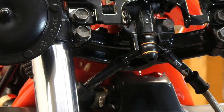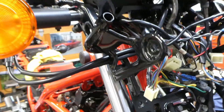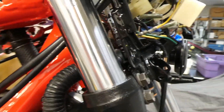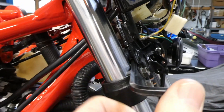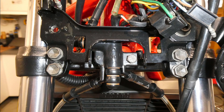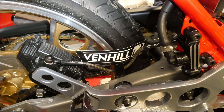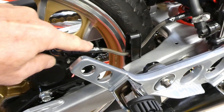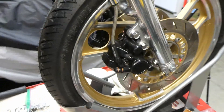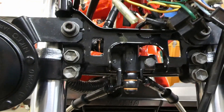And I have one more brake line to put on up to the front master cylinder. That brake line is on now — it's actually a little tricky; it could have been a teeny bit shorter. I thought I was going to have to take the fairing stay off, but I was able to get to the banjo bolt through here. Very lucky. I did remove that horn to get it out of the way. So that's a little bit of progress: rear brake line, a right front brake line, a left front brake line, and a brake line going from a splitter up to the master cylinder.